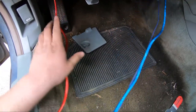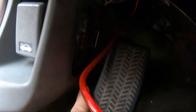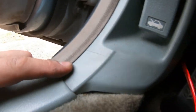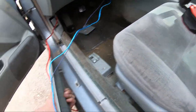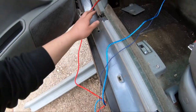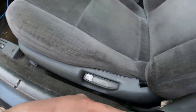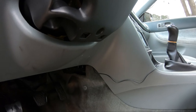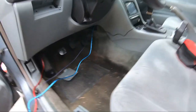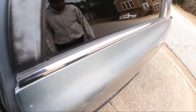So now I'm up to this point — I got this cable, this cable, and my power wire. All three of these I'm going to run right here by the fuse panel. There's a little space where I can run it right through here and then right up under this trim piece — this trim piece just pops off that easy. I can run all my wires right through here, up under the carpet, up above the steering column so they're out of the way from the pedals, zip-tied, and run all the way to the back.